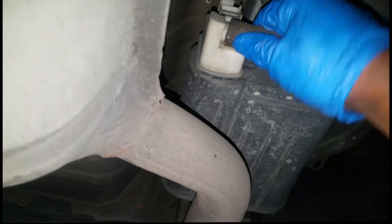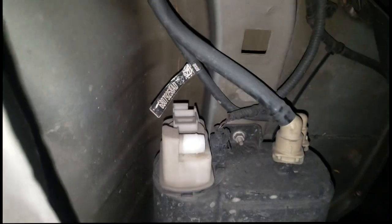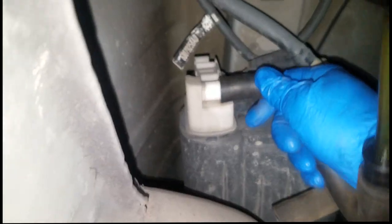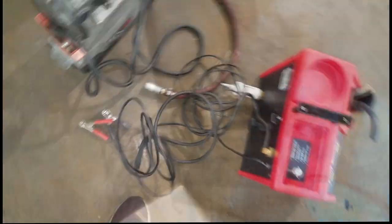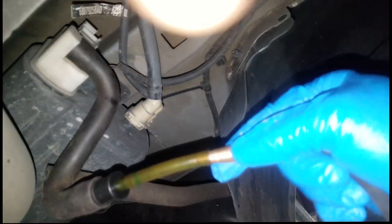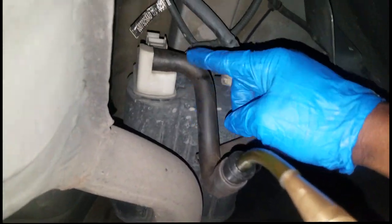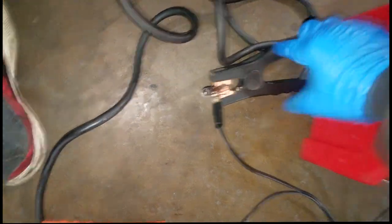So again, at the source — let's get this filter hose off. This hole merely goes to a filter. I'm going to hook my tool to the EVAP system source right here, ladies and gentlemen. From there I'm going to take the hose from the machine and tie it into my tool. I will then activate the machine — turn it on. Again, it takes air supply and 12 volts, so I'm going to apply those to the machine.